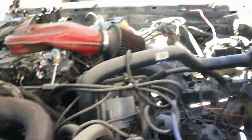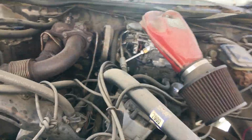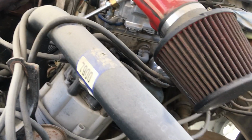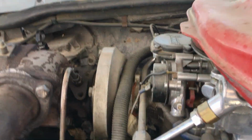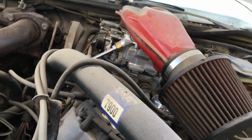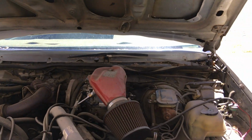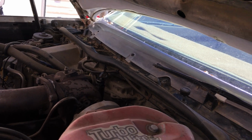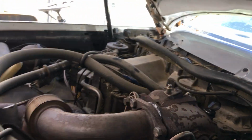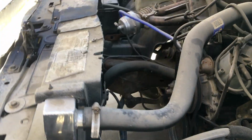And you know, I did a little bit of work, but if you were to look at it quickly, it looks like a pretty original draw-through turbo carbureted Buick V6, but I just did a couple touches to it to improve it, because the 87's turbo was better. I used the 87 for the draw-through and took the AR50 turbo that was original, that was really slow to respond. I took that turbocharger and put it on a shelf. So the original turbo, I still have it. I'm not going to get rid of it. It's a classic turbo, so I keep it. But I got the new and improved version of the draw-through turbo setup.